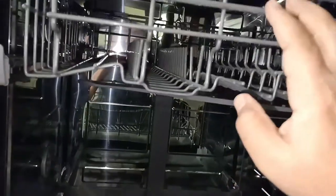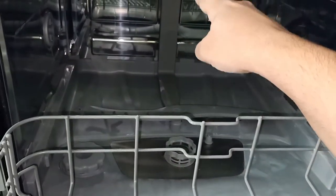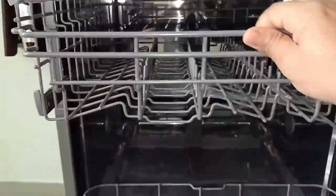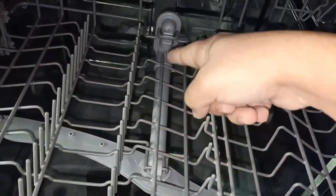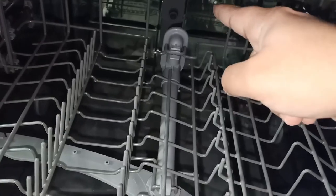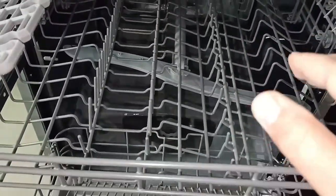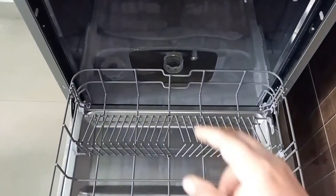Let me show you both spray arms. One is for cleaning utensils on the upper basket and one for the lower basket. Water comes from a pipe to the lower spray arm. For the upper one, there are two holes — water points — and a pipe for the upper spray arm. Water comes through this pipe to the spray arm. There are two points because of the height adjustment — the upper rack can be adjusted to two heights, and depending on the height setting the pipe connects to the specific water point.